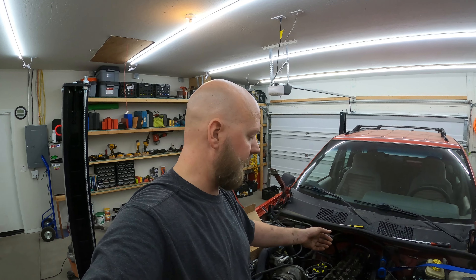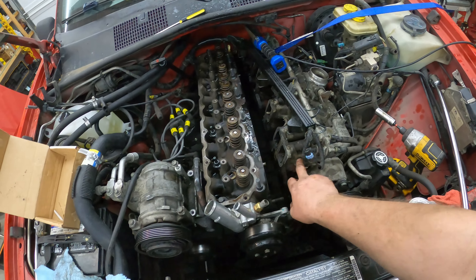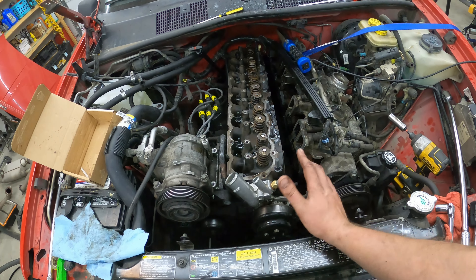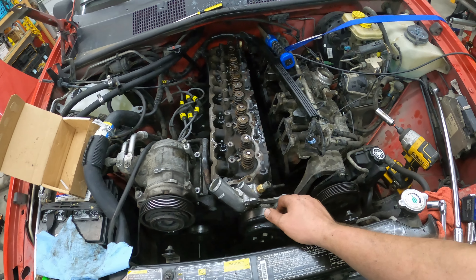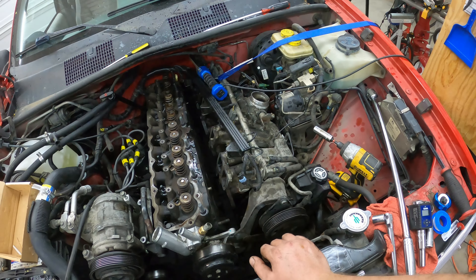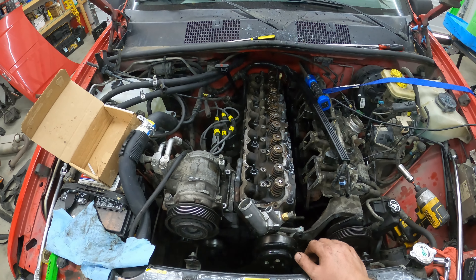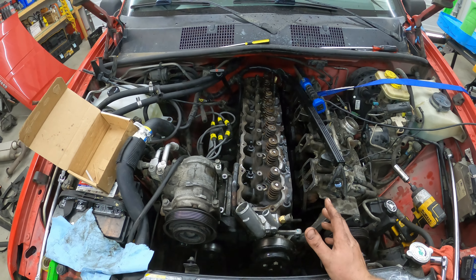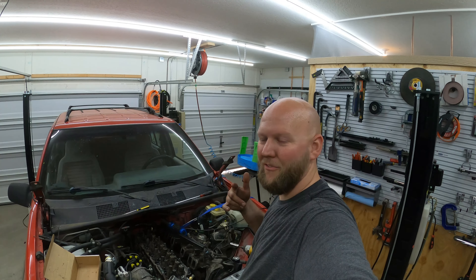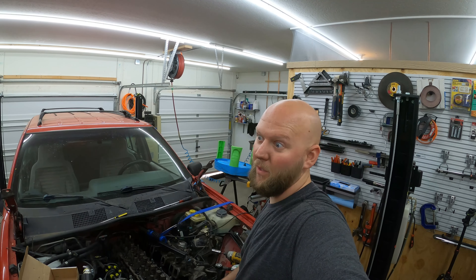Tomorrow hopefully I can put the valve cover on with the valve cover gasket, get the intake manifold and exhaust manifold mounted again, and at that point we're ready to test. I broke pretty much every single one of the vacuum lines on this Jeep, so I'm going to have to figure out vacuum line issues. I put a straight edge on the head with a flashlight and didn't see any light, so I think the head is straight. I don't know why there's oil in the coolant, but for now we're putting this together. In the meantime, I've got to go get an axle — it's going to be a Dana 60, two hours away.